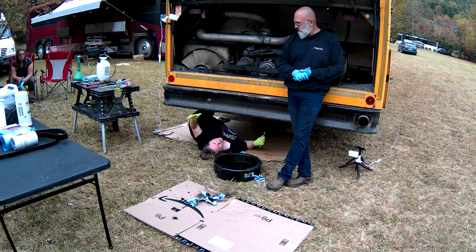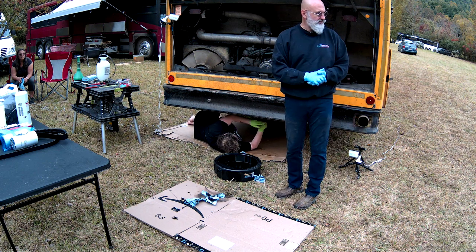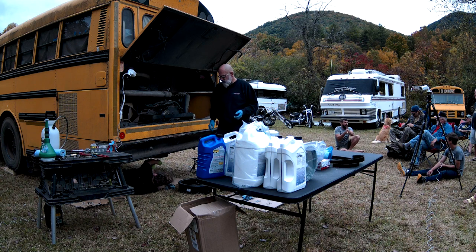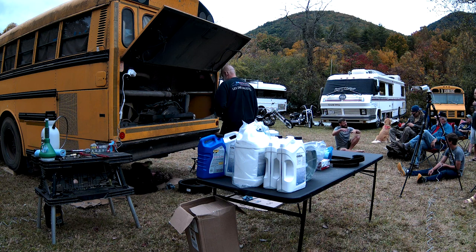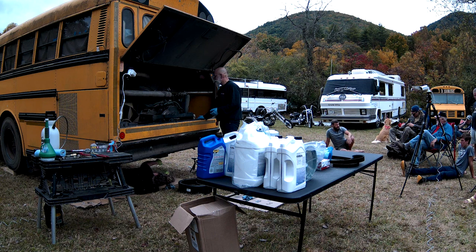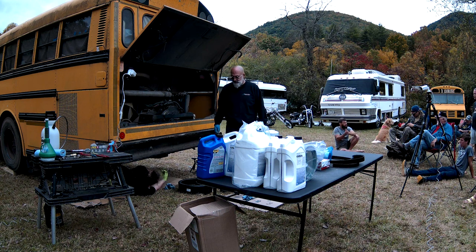The oil analysis ultimately determines at what point the oil is breaking down to the point where it's no longer protecting the engine, so your parts are wearing and rubbing. That's what releases the metal, and that's how they determine your intervals. When they say 5,000 miles, it's saying that with conventional oil at 5,000 miles, your oil is breaking down to the point where it's wearing the engine. Change the oil so that doesn't happen.